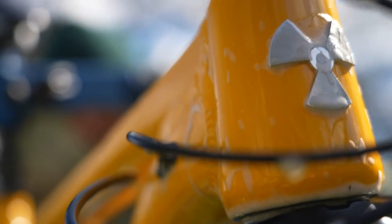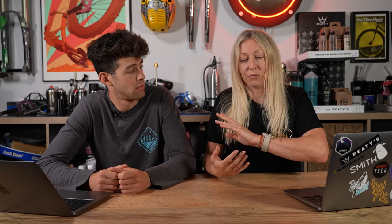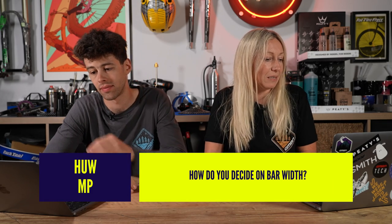Try a cleaning product designed for dry cleaning — there are dust-specific ones that don't require washing. If you're using a jet wash, that's probably speeding up the process of flushing out grease too. Maybe lay off that as well. Wipe your frame down, dust away from headset seals to stop it working in, but avoid a full wash every ride.